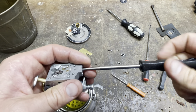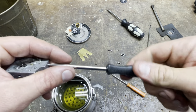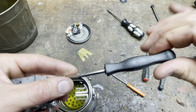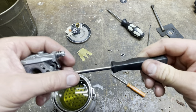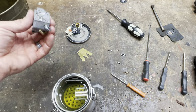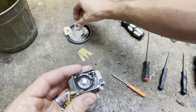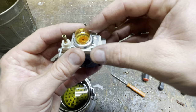When I put these screws back in, I basically bottom them out — but very lightly. Don't crank them down or you'll destroy the seat. Use two fingers, just a very light touch until it bottoms out, then back it off one turn. Bottoming out and backing off one turn gets you close enough that the machine should start without worrying about it being so far out of adjustment that it won't. Gasket down, diaphragm up, as always — fuel pipe on this side.